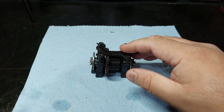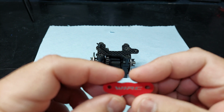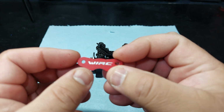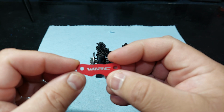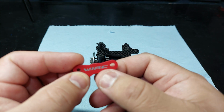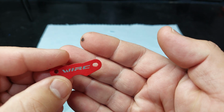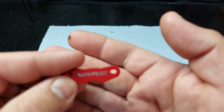All right, so before I complete the assembly by mounting the calipers, I wanted to review what I did with the calipers themselves. I mentioned earlier that I was going to remove some of the coating from within the mounting hole that the screw passes through. Two things: one, I only do it on this side, see how it's a perfect circle there and that one's elongated. I only do it on the side that's the perfect circle. The elongated side really doesn't have any issue.